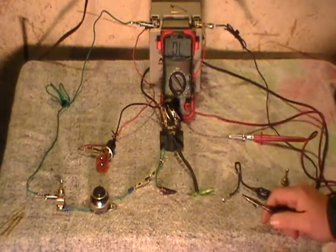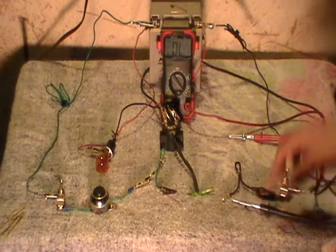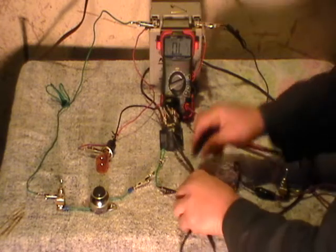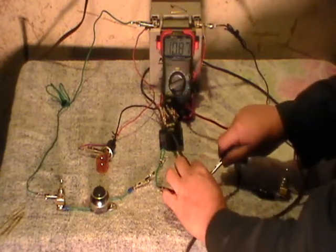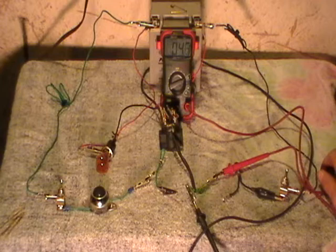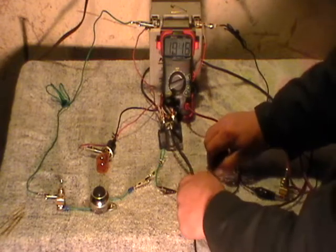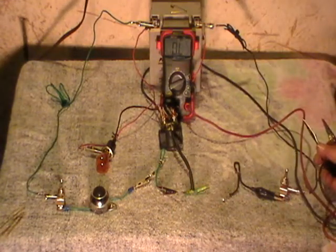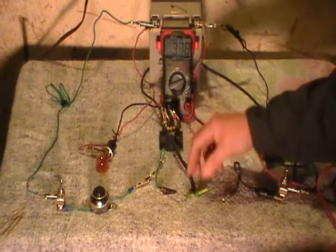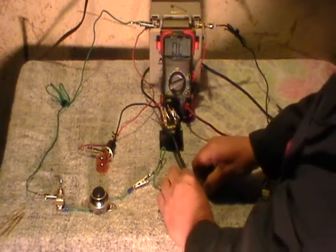If you really want to test the solenoid correctly, there's always some type of value assigned to it. I don't know the exact value off the top of my head, but we change our multimeter to ohms and do the same thing — take one probe to one wire, the other to the other wire, and watch our multimeter. We're reading about 4.7 to 4.8 ohms. The parameter is probably around 5 ohms, so 4.7 to 4.8 is going to be good. We know our coil is sound.